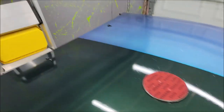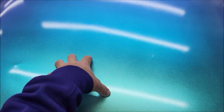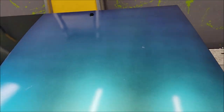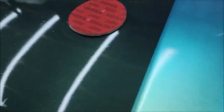So let me show you what's going on. This is the panel I showed you that I sprayed the other day — the blue-green color shift. When you're spraying pearls and flake mixed into this stuff, you want to do 50% overlapping passes or it ends up blotchy. I really just wanted to lay down some material, wasn't necessarily trying to get full coverage. You can see it's a little bit blotchy — there's a little lightness in this area, but no big deal. I did spray it outside, there's asphalt and it's very dusty, but it sands out just fine.